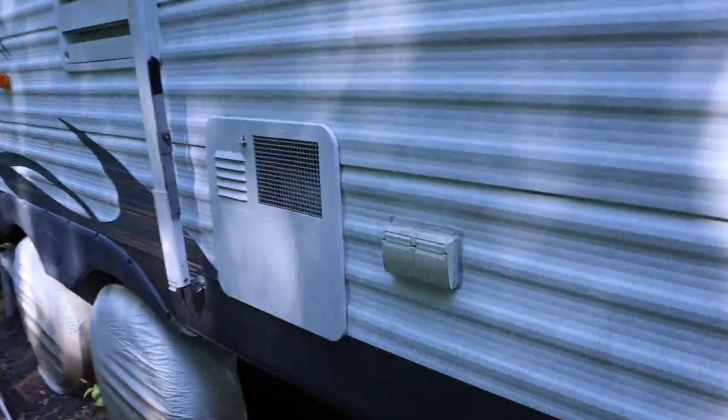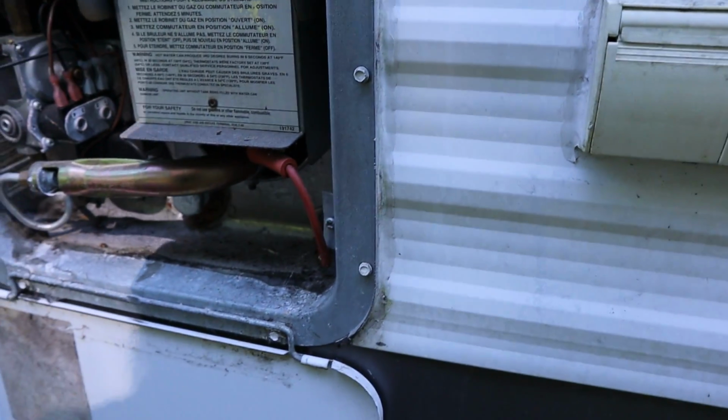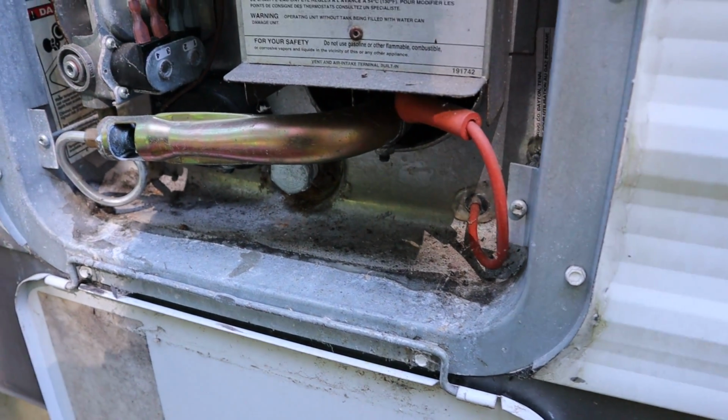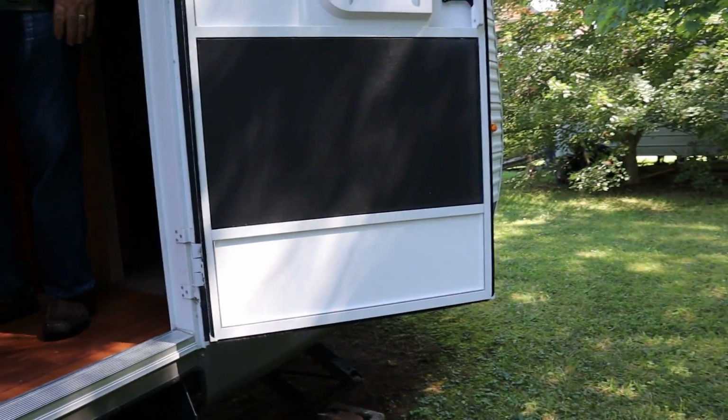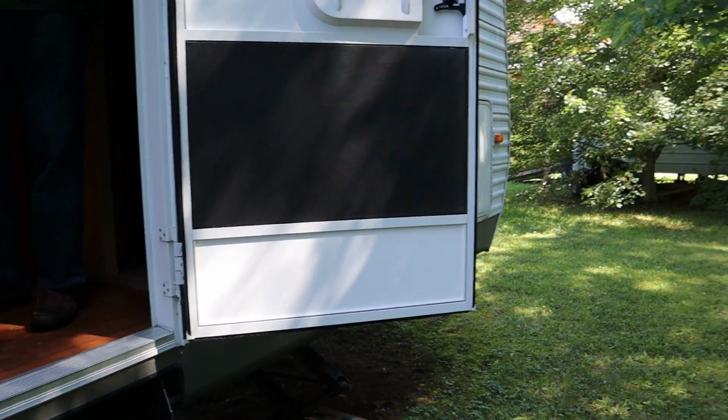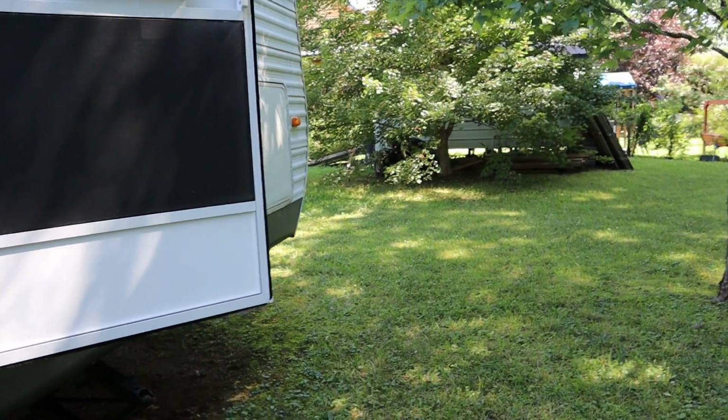Let's go out here to the water heater. Yeah, it's trying to ignite. All right. Do we have gas in the cylinders? Yeah. Okay. No, we're supposed to. They were filled, but okay. We have neighbors that, yeah, pilfer. Help themselves. All right, so the water heater is trying to ignite. The gas valve sounds like it's trying to open. I don't smell any gas, so let's go make sure we have gas.